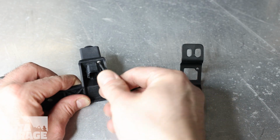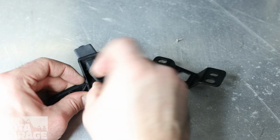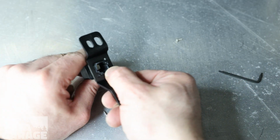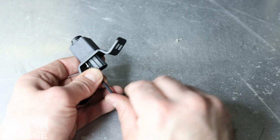Once you remove the camera from your factory grille, it's time to transfer it over to a new camera bracket. Using a T3 hex Torx Allen key, remove the two T3 bolts securing the camera to the OEM bracket. Up next, slide the back of the camera into the new relocation bracket and secure it using the OEM T3 bolts.